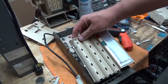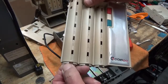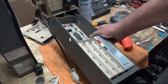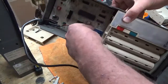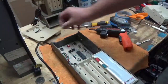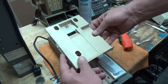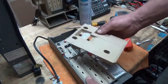Now reassembly: line up the three coin tubes — they're recessed and go in about an eighth of an inch — while also spreading the case. You feel it go click click — tabs are in the notch. Very carefully plug in the ribbon cable; make sure you don't bend a pin over. Now comes the cover. Some of these covers had a little tab here that you had to go down and in — a lot of times those tabs would break off because guys were too rough.